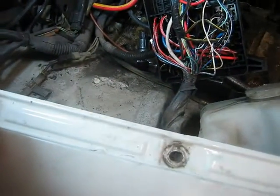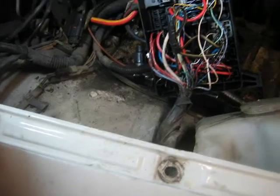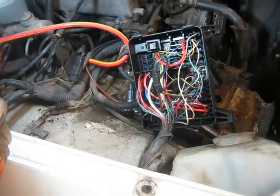That's the same size on the alternator, but we've got one round in the cab up under here. So just look around, and that's it there. Okay, so in summary, the fuse box gets its ground from multiple places, but it gets its power direct from the battery.